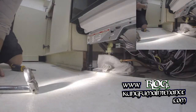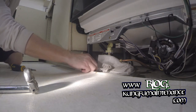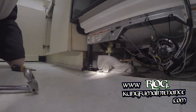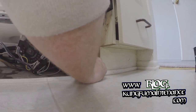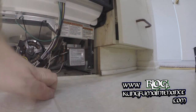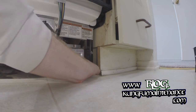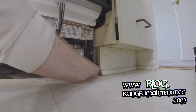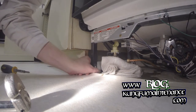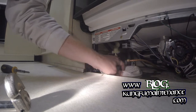Now to make pulling this out a little bit easier, what we can do is lower down these front legs, just to make it getting over the vinyl a little bit easier. The vinyl's also getting replaced here. I'm lifting up a little bit on the dishwasher to make turning the feet a lot easier.